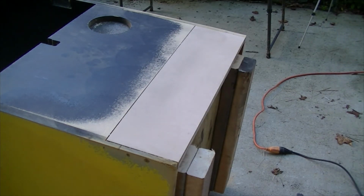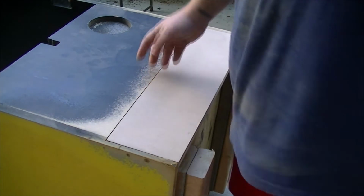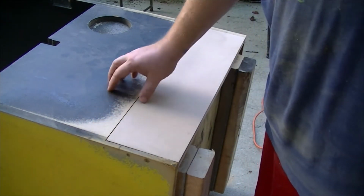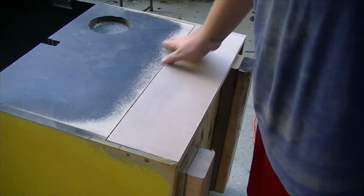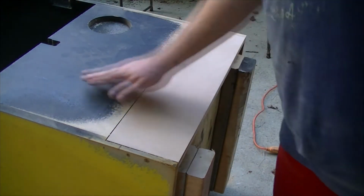Pretty good about that. It's nice and smooth. The gap is a little bit wider than on the front, but two things: A, it's on the back, so nobody's gonna notice it, and two, you're never gonna see it once we fan the Bondo, because we'll fan it about an inch each way and then smooth it all out with 220 before we paint it, and it will just be gone. It will look like one solid piece.